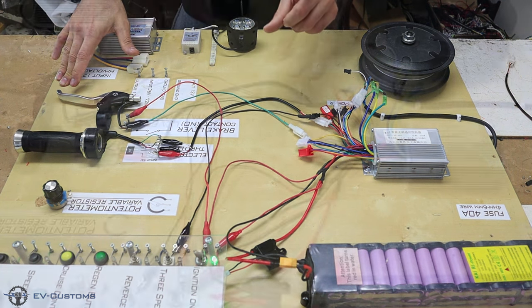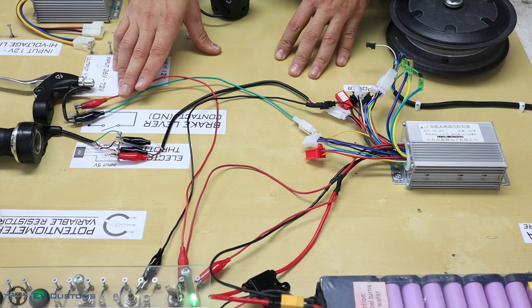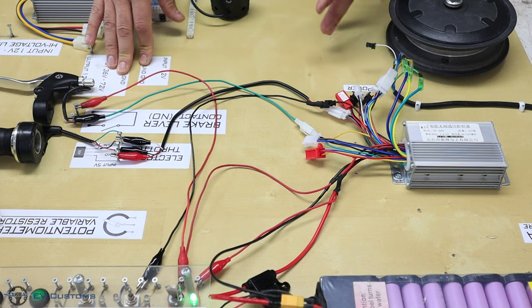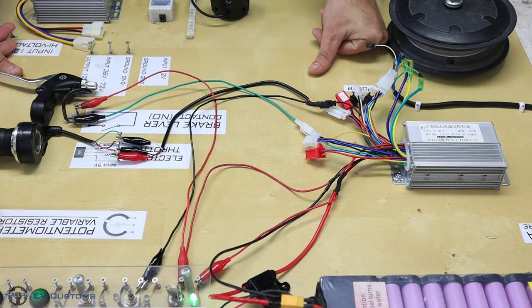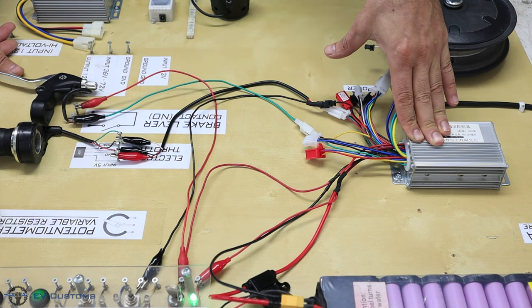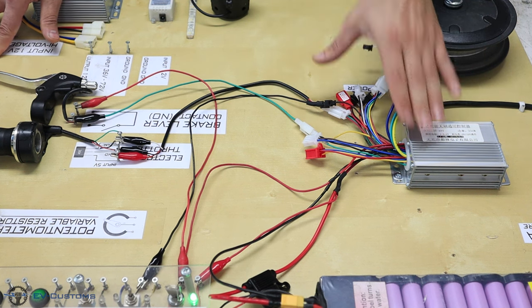The difference is that on high brake, I can put a load there. If I have a stop light, I can activate it by the handle brake. On low brake, you cannot do that — most probably you will burn your controller. If the signal output is not isolated, you will burn your controller for sure.